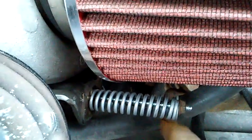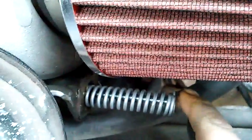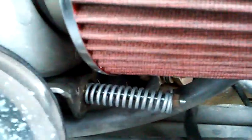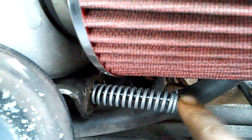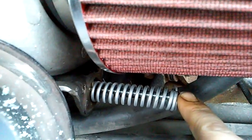Get two or three washers, stick them on this end. Then find any old nut — I had two on here. One was a jam nut to make it so it wouldn't back off, but apparently the jam nut backed off and the regular nut stayed. So you've got to keep an eye on this, because that's where the boost gauge reading plays off too. You'll be able to see when you start losing boost and all you have to do is come turn it up again.